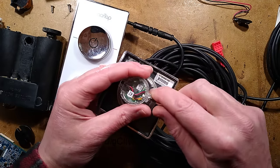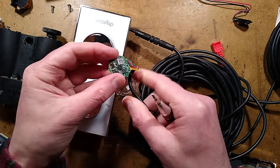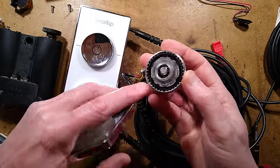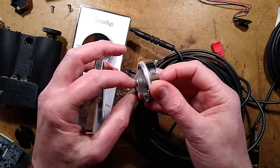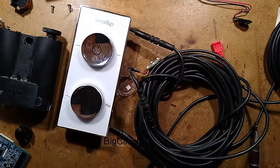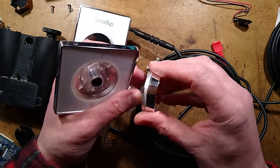If you take a look at these taps, by popping this off there's a little circuit board with a set of four LEDs and a rotary magnetic sensor that uses the Hall effect. It's also got an inductor in the back that I think is used to detect the button being pressed by the sudden transition of magnetic field — that's what I was trying to show earlier. If you pull the knob off the front, this is just a magnet in there, and it's detecting north and south orientation for rotation. The indentation clicking effect as you rotate is strictly built into the knob — just a tactile feel.